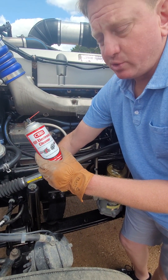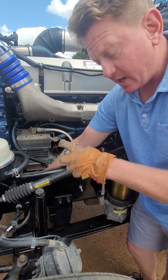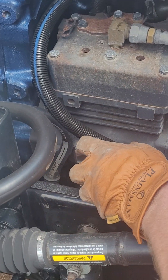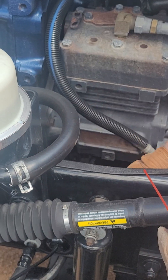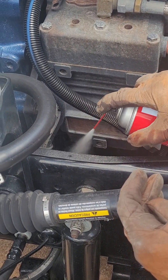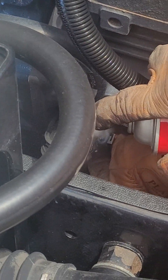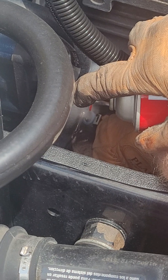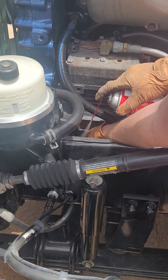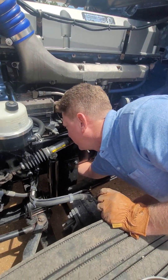Having some good specific electronic cleaner is what you want to use — you don't want to use brake cleaner or anything like that because it'll dry out the plastic and the rubber. Take it and get it as clean as you can, deep down in there. Then do your best to get the cleaner into the sensor too.